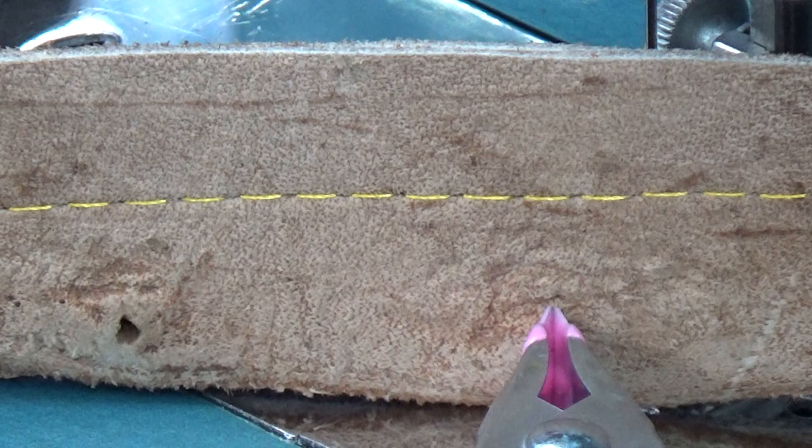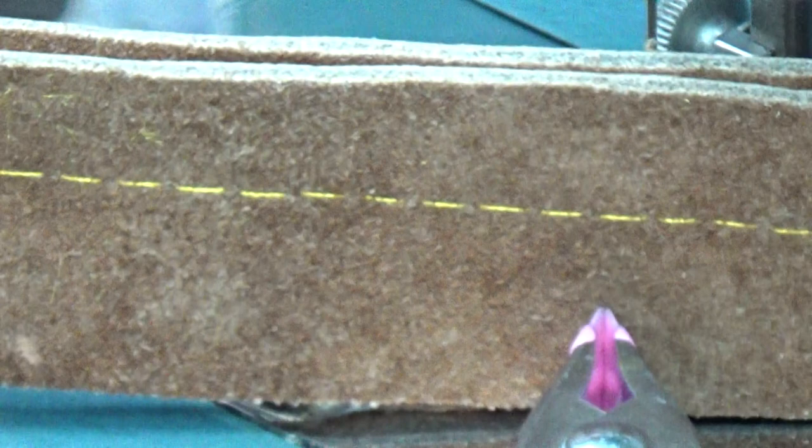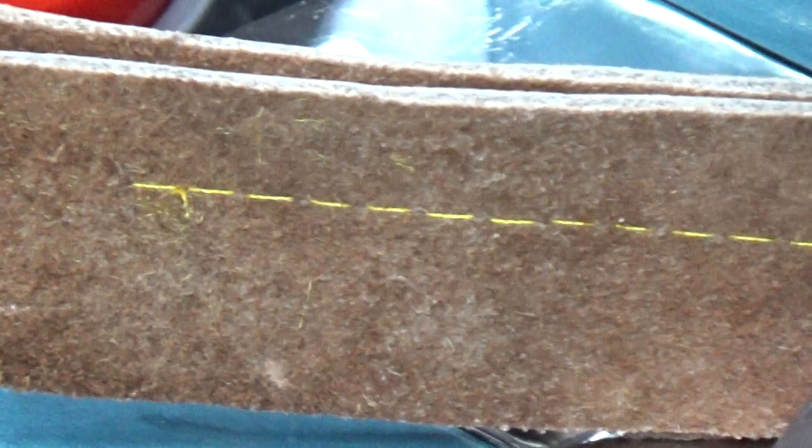Let's turn it over and look at that lock stitch. There we go. So again, a lock stitch is always going to be a little bit more difficult to produce because of that gravity factor of pulling that embroidery thread, 50 weight embroidery thread. Actually, correction, it's closer to 40 weight embroidery thread by Coats and Clark. So 40 weight embroidery thread, this trilobal stuff, pulling it all the way back up through those two layers of genuine elk hide. So it's done a fantastic job. The look of that stitch is exactly what we want to be seeing on page 34.